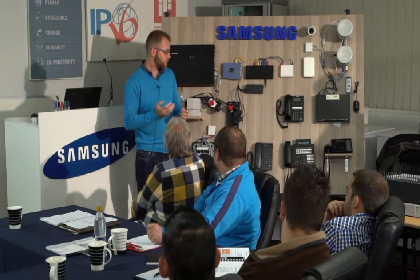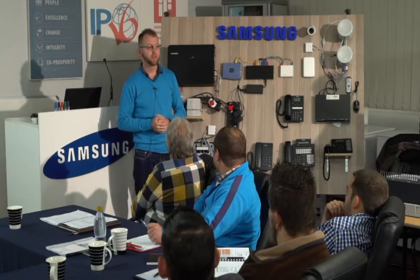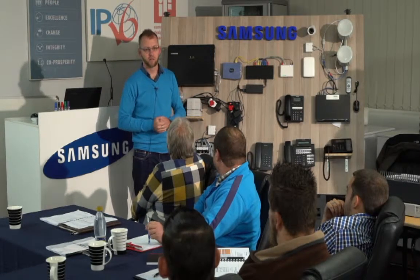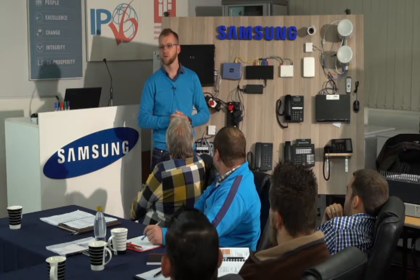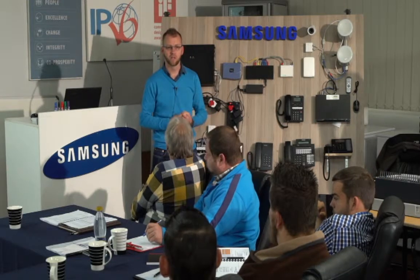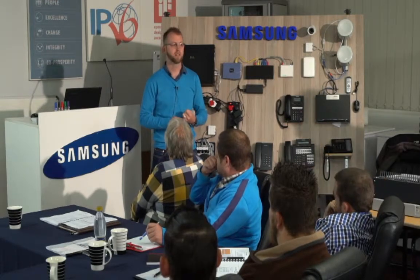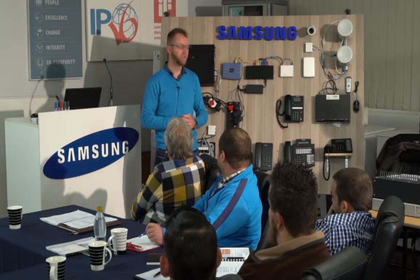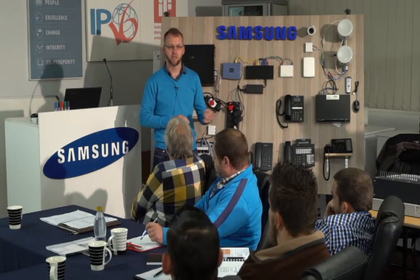So once you get to a site with a mobile solution, hand out the cell phones immediately. Tell the user, here's your cell phone, set it up. Once the user has set up the phone, they give it back to you. The reason why we do that is it's an Android device. Any Android device, if you want to go onto the Play Store, we need to have an email address, a Gmail or Google account, on the phone. So they put in their details there, otherwise you're going to create your details, the client's going to get the phone, and he's going to wipe the phone and reconfigure it for himself again. So give the phone to him, he sets it up, and all he has to do for a basic setup is just create a Gmail account, for example.